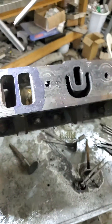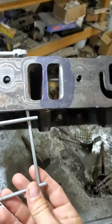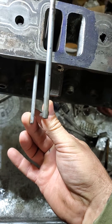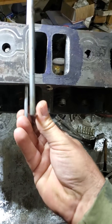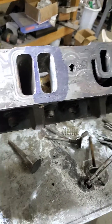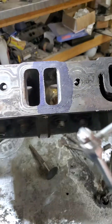To measure a port it's a mirror image — you just flip it over and come in from the top and do the same thing. This one is about five-sixteenths, which means it's well over an eighth of an inch thick still, so it's got a ways to go. But that gives you exactly twice the thickness of the wall.